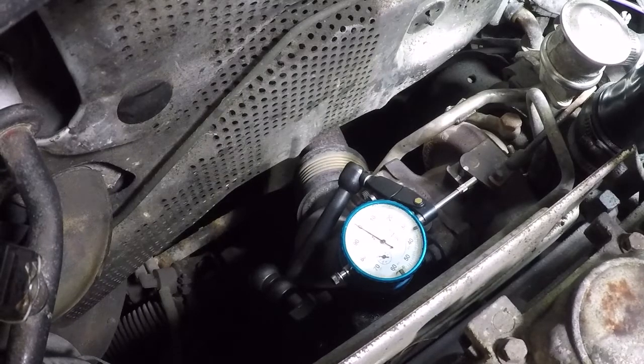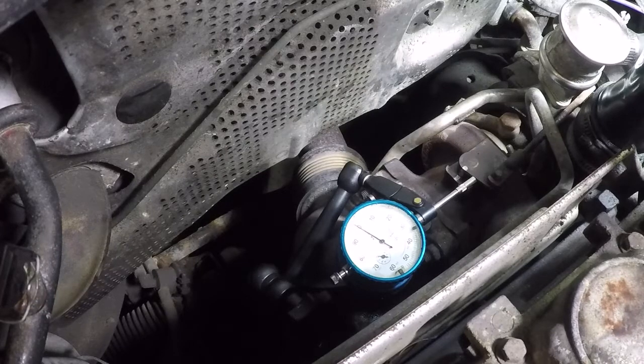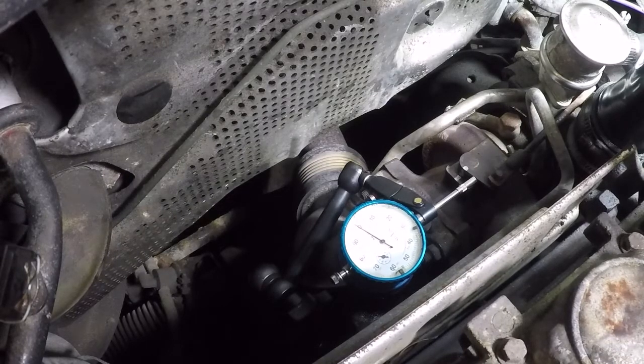How does it do that? If this wastegate is supposed to open around four PSI, that's low pressure. How do you make it go higher than that? Part of that is they fake it out — they take some of the pressure going into the wastegate actuator and dump it back into the air cleaner intake. This is very common practice. Basically the wastegate actuator, once you start electronically dumping some of the pressure applied to it from the manifold, it goes a little higher than expected. So your boost pressure goes up under tight controls of your engine control. If it sees knocking or something weird with temperature, it will cut that pressure back, and you're back to your base wastegate again.